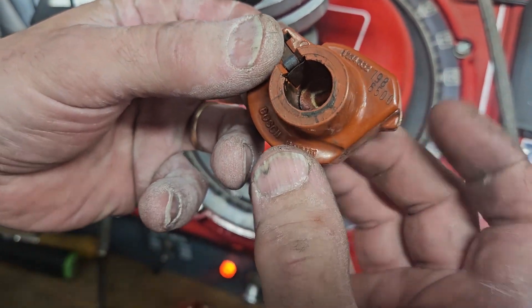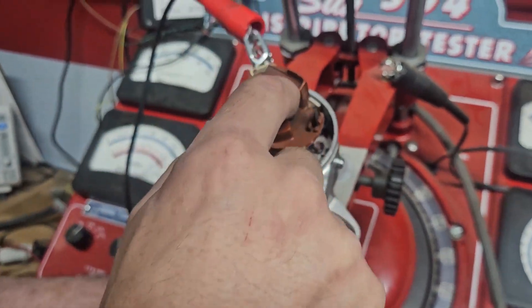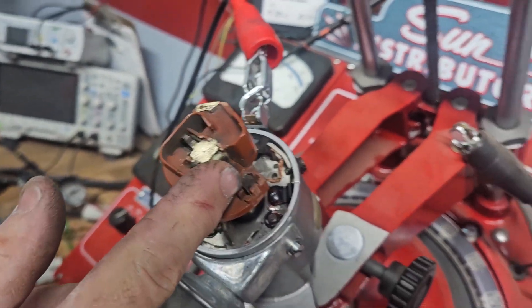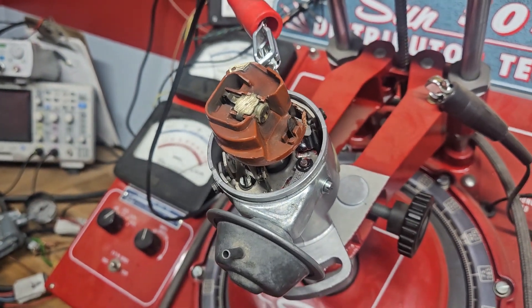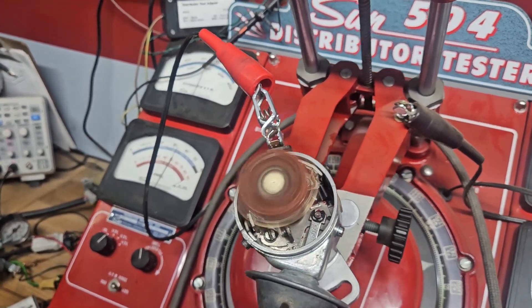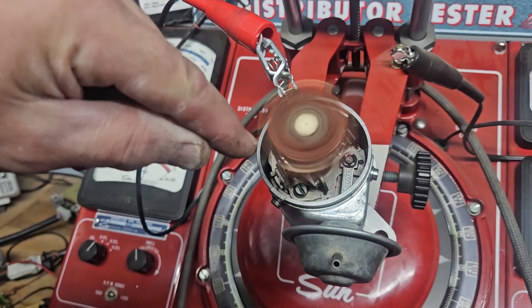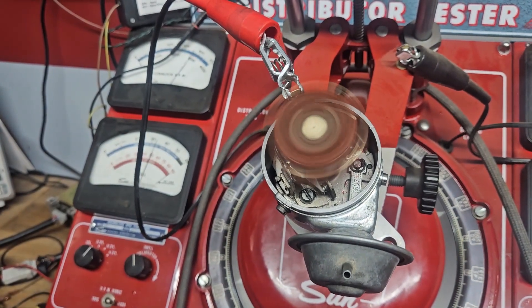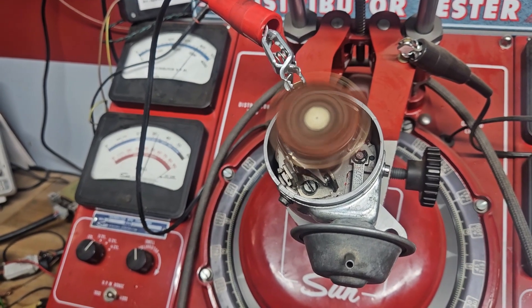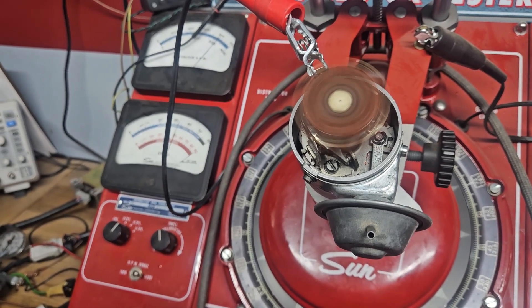So let me grab the other rotor. The original Bosch rotor, 6500. I've just cleaned the contacts. And the difference with these is you can actually see this come out. The spring is set so much nicer in these — you can hold it right off the rev limit until it contacts. Okay, it's starting to move out. See it moving out. Moving out. There's 6000 RPM, still moving.